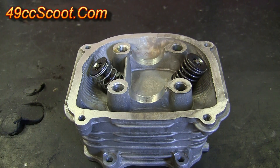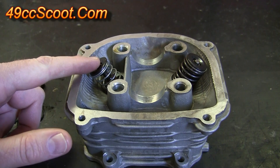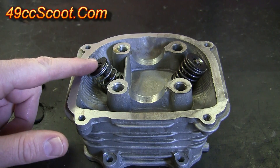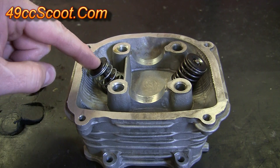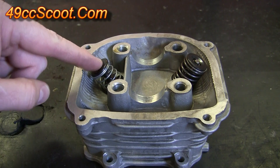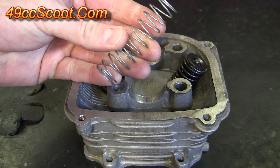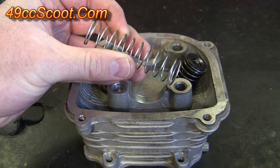To do this test you should use checking springs. A checking spring is basically a very soft spring — it has enough tension to hold the valve closed but very little tension so you can easily push on it, and you will need to press the valves down to do these tests. I found a spring like this at a local hardware store for about a dollar.